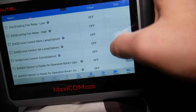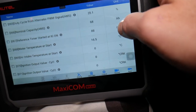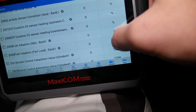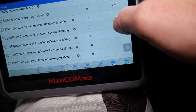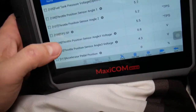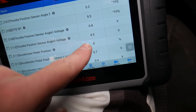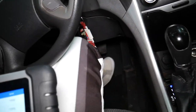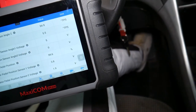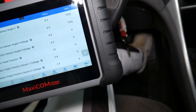In live data you can see all the parameters — temperatures, everything about your engine, ignition switch status, main relay, battery temperature, reference water temperature, fuel adaptation, and more. Scrolling down, we find the throttle position right here. This is the throttle body accelerator pedal position shown as a percentage — zero percent at rest — and you can also see the voltage reading.